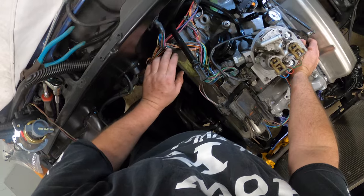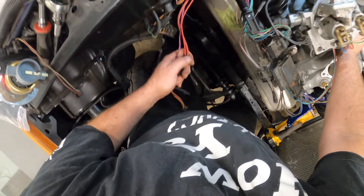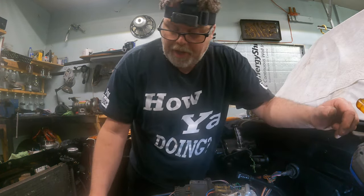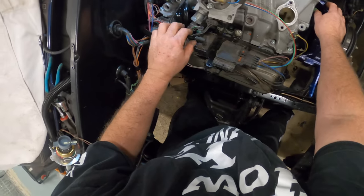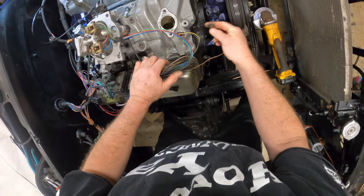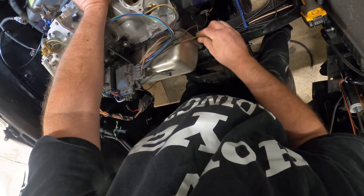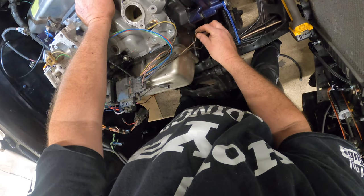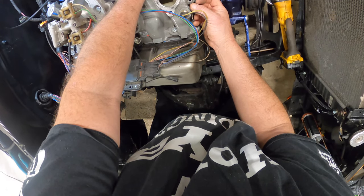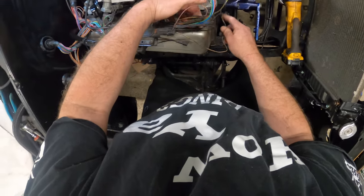See, there were a few things I forgot when it came to putting the distributor in — I get ahead of myself. I might just leave the distributor out until I get these wires tied up, because it's right on time and it's tricky to get in there. I gotta take all these wires back off and cover tape them all up. There's another ground here — I'm thinking I'll pull a water pump bolt back out and put it behind the alternator onto the water pump bolt.